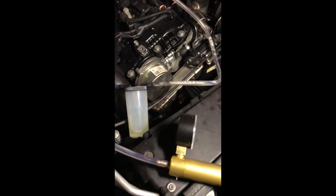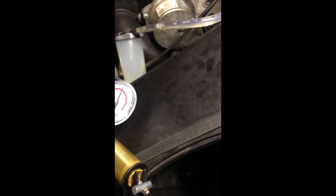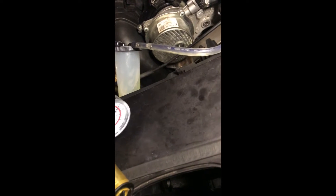Here you can see the air bubbles coming out of the system as I've got it drawing the vacuum — I've got it on about 20, which seems pretty good. When you release the vacuum, just be careful it doesn't draw the air bubbles back up. I repeated that process for three of the cylinders. I didn't see the need to do all six — I did the three with the easiest pipes to access, which are the ones with the bent injector pipes.